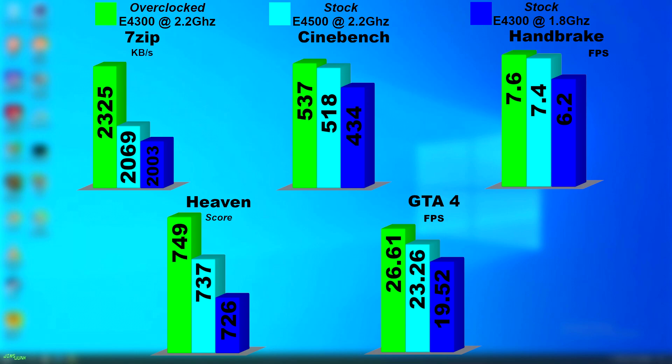Some who weren't using PCs when these were new may be thinking, well, of course it's going to be slower unless you overclock it — but that's not the point. These things were so easy to overclock. You could pay for a low-end 1.8 and overclock it to 2.2 with no problem, and it would easily beat the stock 2.2 that Intel released. This was a very minor overclock, but the 1.8 could go way higher. Many often ran these daily at a 1066 FSB, bringing them up to 2.4 GHz. A 1333 FSB would likely be possible with the right motherboard, bringing it up to around 3 GHz. You could buy a 1.8 GHz bottom-of-the-line chip and easily clock it much higher with zero problems, often with the stock heatsink. These CPUs were great for so many reasons. If you've made it this far, I want to thank you and hope you had a wonderful holiday — I'll see you next time. Bye-bye now.